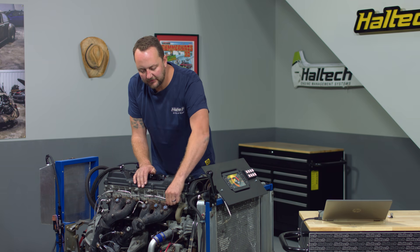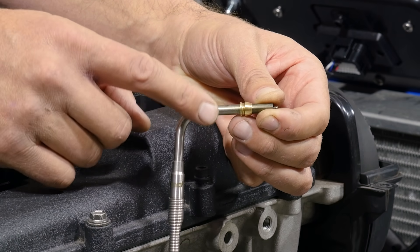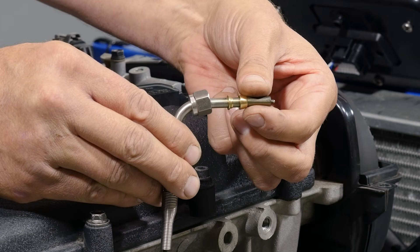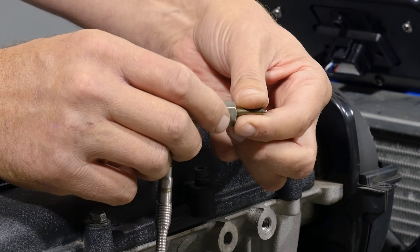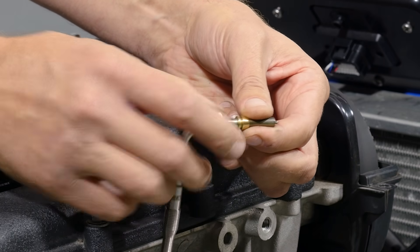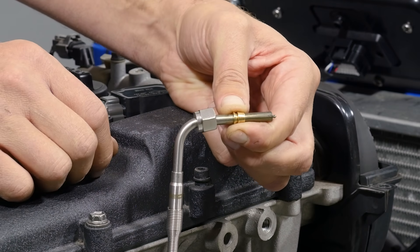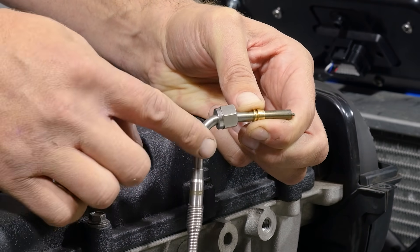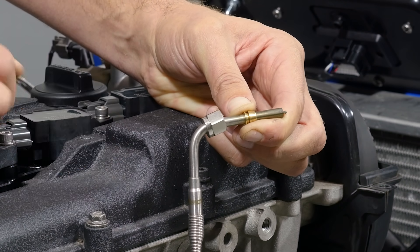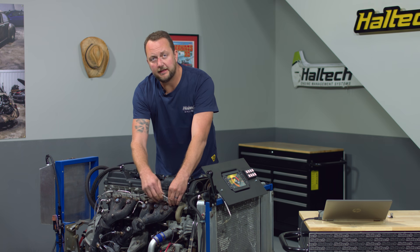I'll pop this one out of cylinder one — I've left all of these finger tight for now. So here's how this would work: this is the top nut, we've got the locking ferrule just here. We would get that down into the cylinder at the right height, pull the nut down over the top, and twist it onto our weld-on bung. This top part — the nut is captive — is locked onto the body of the EGT. If we ever needed to replace this sensor, we'd need to order a new sensor, probably not the nut, but it normally comes with a nut and ferrule set. So we've talked about what the sensor is, how to fit it, and how that little nut works.